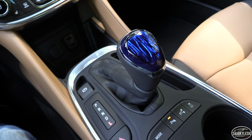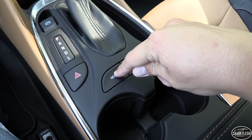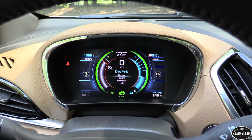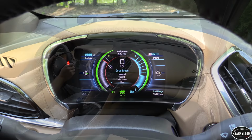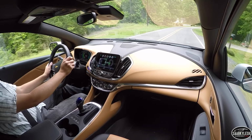Like before, the Volt comes with four different driving modes, including Normal, Sport, Mountain, and Hold. Normal is the default day-to-day setting, while Sport increases throttle response. Mountain enables the engine and battery to combine power in order to boost performance when going up steep grades. Hold, like the name suggests, holds the battery's current state of charge for later use. In other words, it switches the car into extended range operation for long-distance highway commutes. Once you arrive to your destination, presumably in the city, you can then run the car in full EV mode